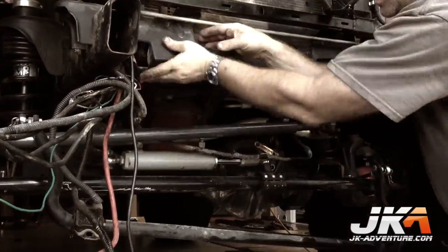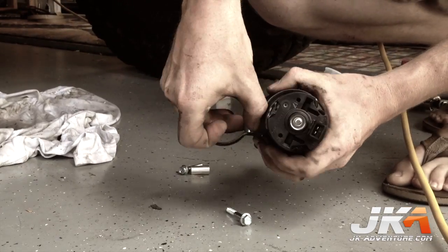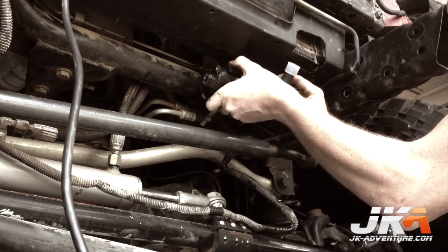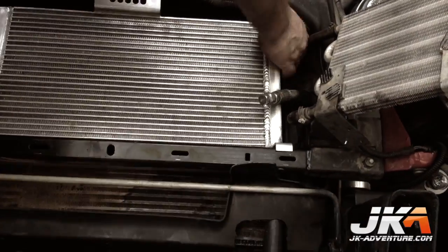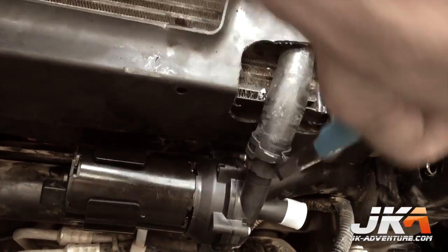Reinstall the drip pan using the stock plastic pushpins. The intercooler pump brackets utilize the provided bolts and spacers — the short side of the brackets are then placed over the cross-frame support and tightened down. Cut a six-inch section of three-quarter-inch hose and connect it to the lower barb on the heat exchanger using a spring clamp. Note: the instructions are very specific about where to use a spring clamp versus a worm gear clamp. Insert the heat exchanger back into place, guiding the hose through the opening in the drip tray, and connect that hose to the intercooler pump using another spring clamp.